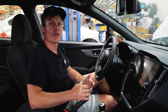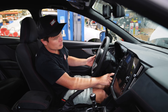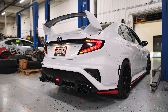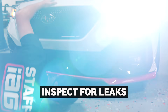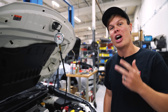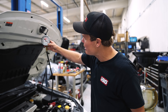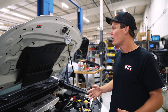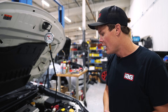For this next start, I'm going to let the car run for approximately 30 seconds. Everything looks okay — we've got oil pressure so we're ready to start the car up regularly. We're officially on our third start and we're going to let everything warm up and come to idle. As you can see, our oil pressure has dropped and it's hovering right around 79-80 psi, which looks good. There's quite a wide range you can expect depending on your engine, oil, and temperature, but now we're ready to go to the next step.